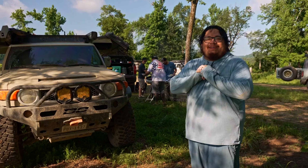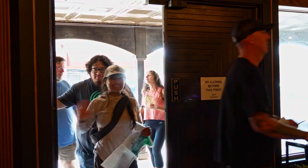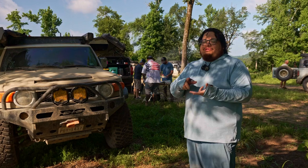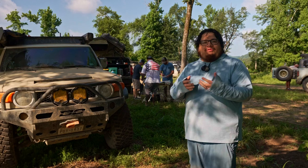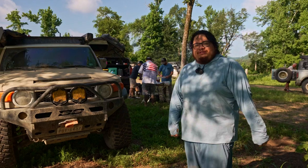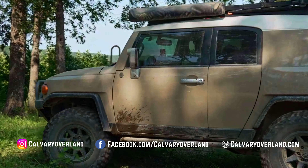All the suspension I cherry-picked, so it's a lot of Fox suspension. We try to maximize long travel and also articulation both up and down. The rear actually has Tundra shocks modified to fit the 120 platform, which gives about an inch more of articulation — that makes a huge difference on the trail.